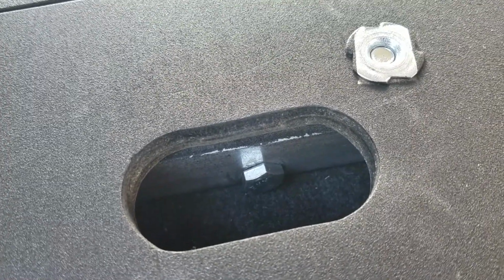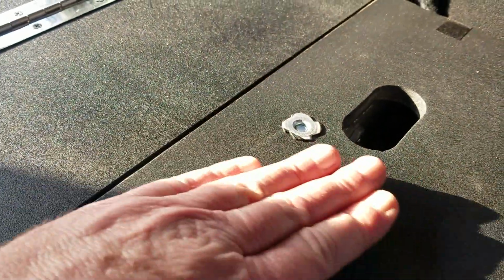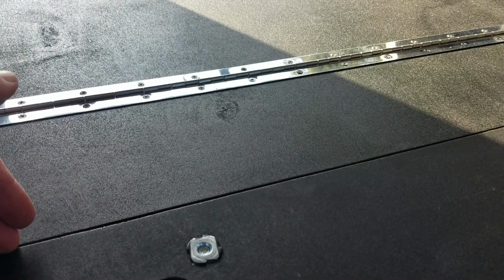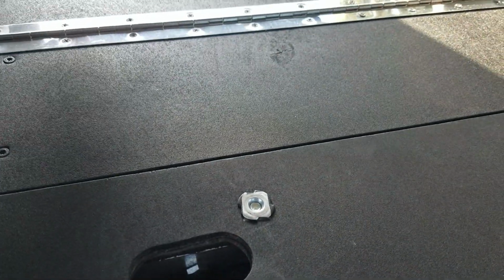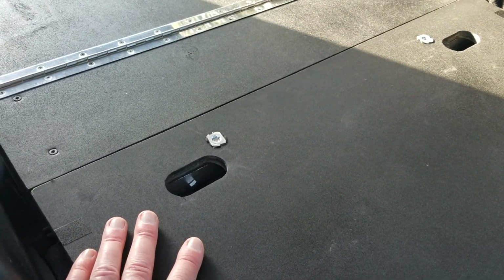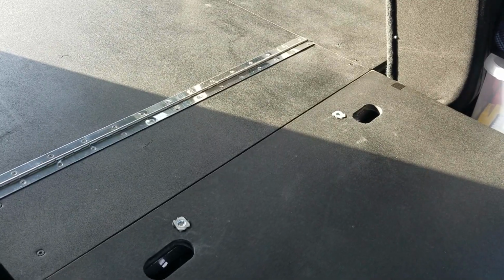And it's bolted on the bottom edge of this front section with these 2, I think these are called T-nuts. They're level with the surface, and the 2 bolts go through the plywood divider bulkhead here underneath and into the back storage section, which I'll show you in a minute. And then I just used 2 wing nuts from the inside of the storage section to tighten up the bolts. That keeps everything level, and it keeps it just solid and in place. And I've had no issues with it off-road or anywhere else. It's held up now very well.